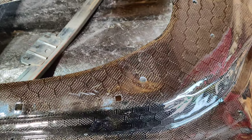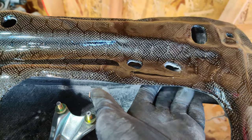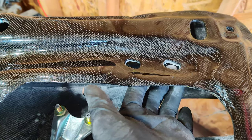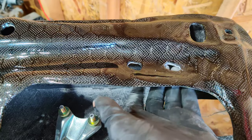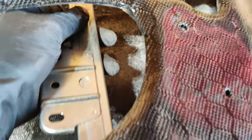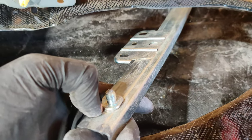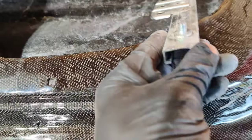These two top holes fit perfectly after I dremeled them from underneath — the layer of resin was too thick and wasn't allowing it to sit well. After dremeling, it sits good enough to get several threads into the nut. The bottom one here is the issue — there's not enough thread to run any bolt through. I'm going to sand more of this down with the dremel to get it to a better seating level, but there's a bezel here that might limit how high it can go. Let's give it a shot.